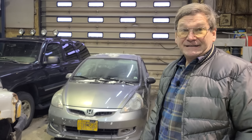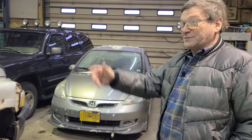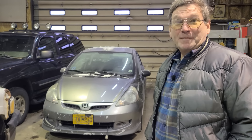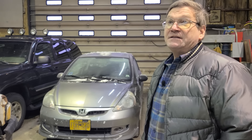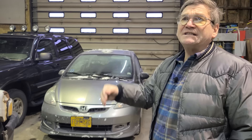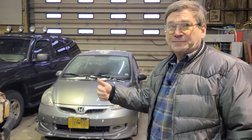The diesel-fired ones are pretty slick, though they will drain your battery because they take 12 volts. There's the ESPAR, the Webasto — I think they've been around longer — and a whole bunch of Chinese ones. The air heaters, the ESPAR and the Chinese heaters, are pretty much the same for heating air in the cab. But for the ones that heat the engine, the ESPAR has more water exchanger in it than the Chinese ones, so it's more efficient as an engine heater.